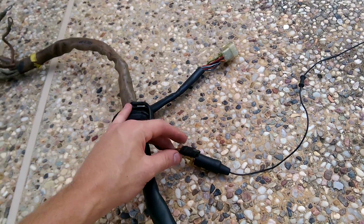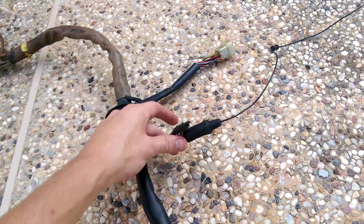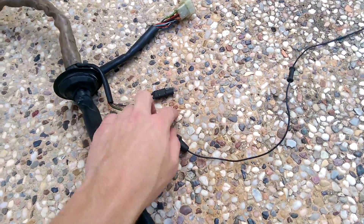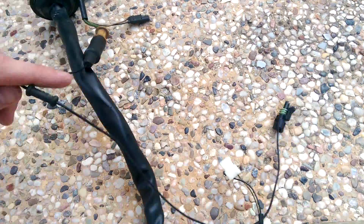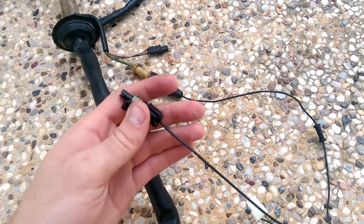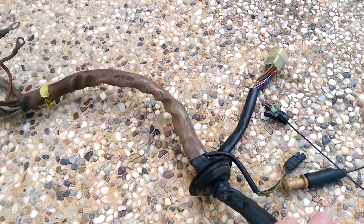I'm not sure what this goes to, but it's kind of a funny two-pin. I believe it might have been for an O2 sensor, like a heated O2 or something, because this has some previous owner modification to it. This is the normal wire for the O2 sensor, but it's been modified. The previous owner decided to install a one-pin weather pack connector, which is actually pretty nice because you can install whatever you want, but your car will probably be different unless a like-minded person has come across it.